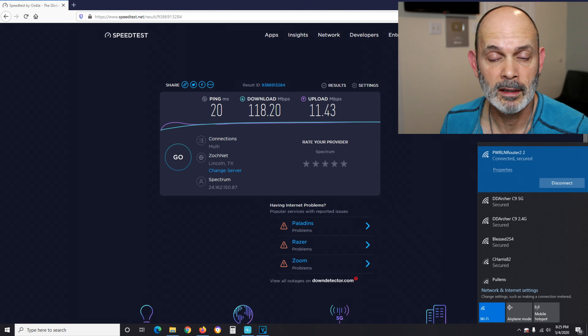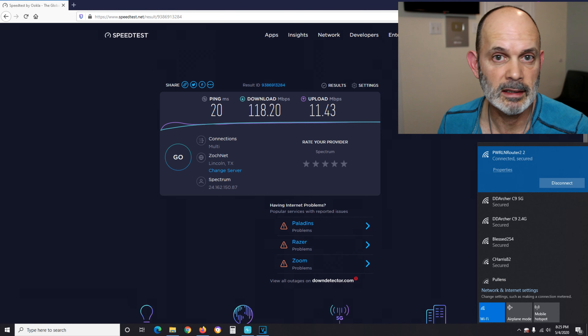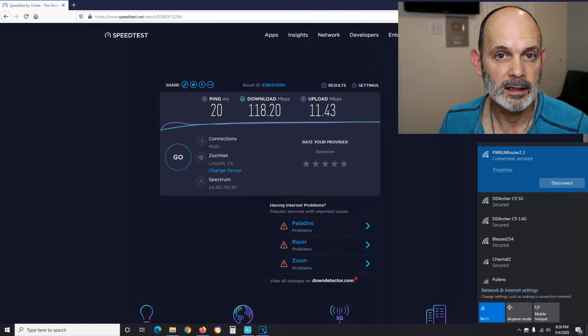Once you've got that, you should have a decent connection. What I've got hooked up is an Ethernet cable to the LAN ports — this is my Archer C9 TP-Link router, connected to the internet through a cable modem on the WAN port. You can connect other things to the remaining LAN ports as well. The secondary router is in another room, connected through the LAN ports to the powerline adapter with three green lights again, plugged into the wall outlet — and I know I've got communication.